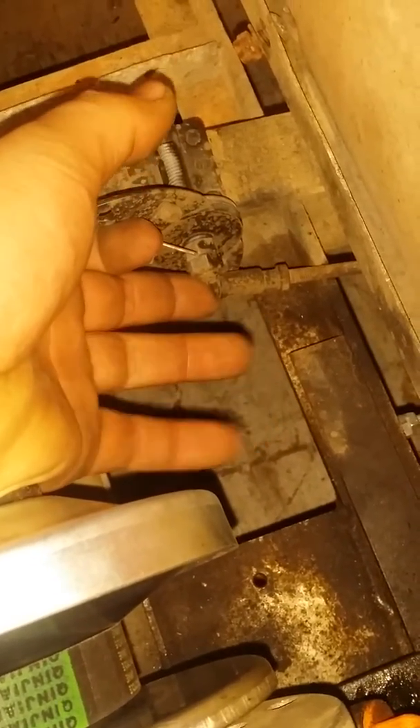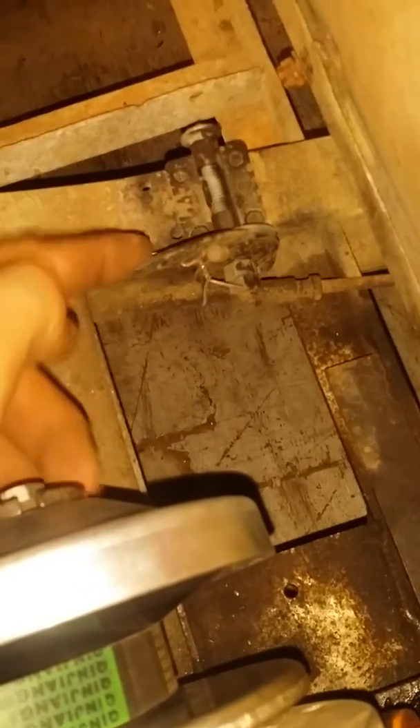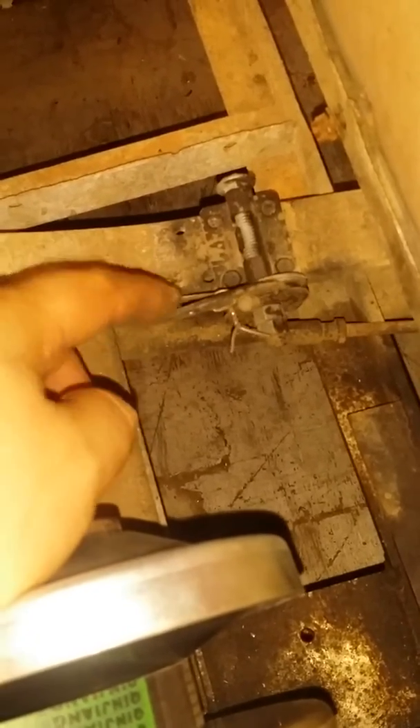So right now you could pull the handle and it would start. Take the cover off, we'll go in here — you have custom throttle linkage. This is your original one; this would have gone to the electric linkage that would control how much power you sent to the motor itself. I made this little rinky-dink thing out of some random stuff, going to a throttle cable. Throttle cable goes all the way back around, comes back to the carburetor.